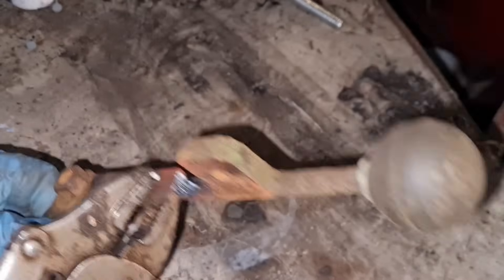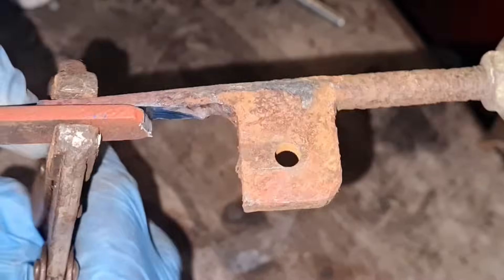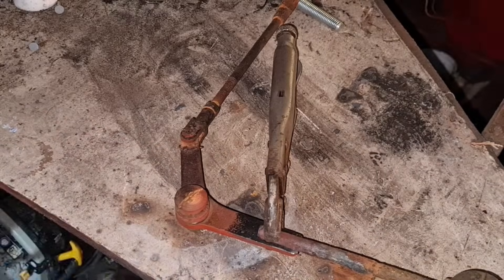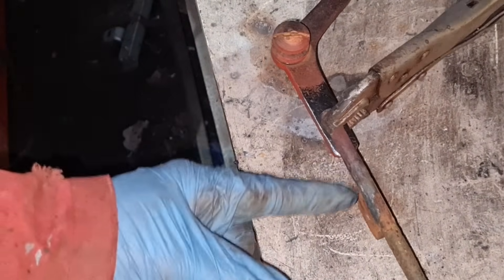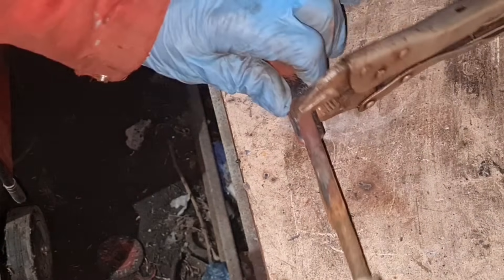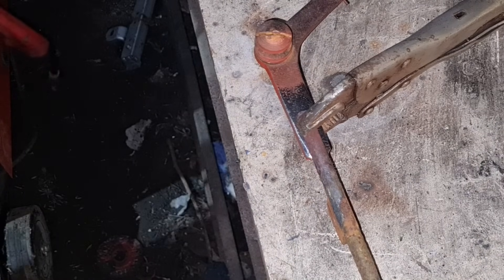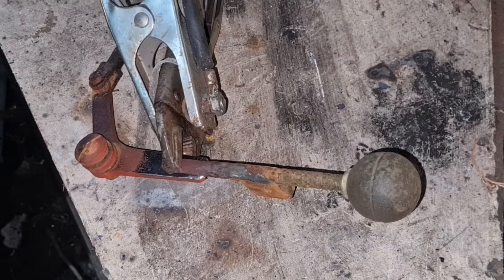Right man cabers - I've got the gear knob off the old Barford Atom. I've cut the hook off the bottom, I've cut the knob off the end of the original Bonser gear stick, and I'm going to weld these together. I've ground a flat on here and that's now welded - we're now going to weld this back on here together. Hopefully that'll hold, and our joint will be underneath because it will come through the gear stick and through the gate there. So our weld is going to be all underneath so I won't snag up. Let's get an earth on here - mind your eyes guys.